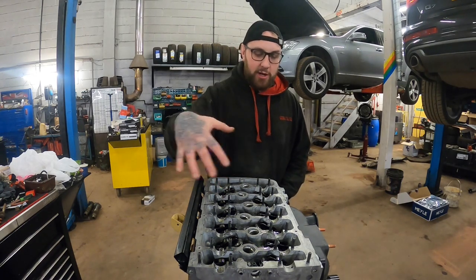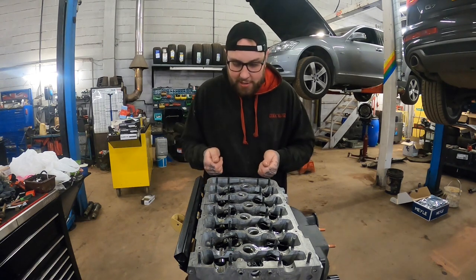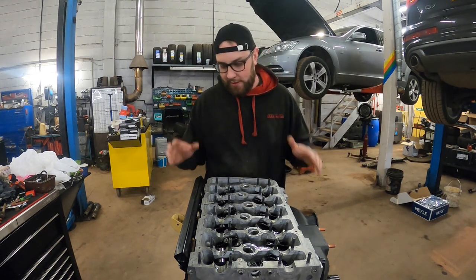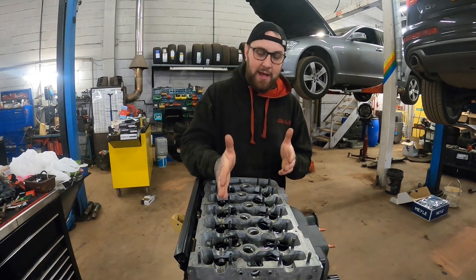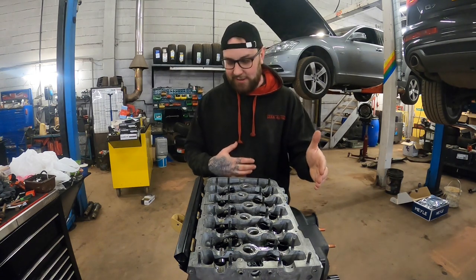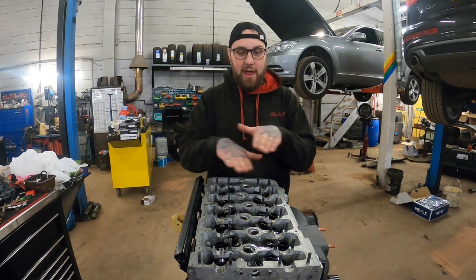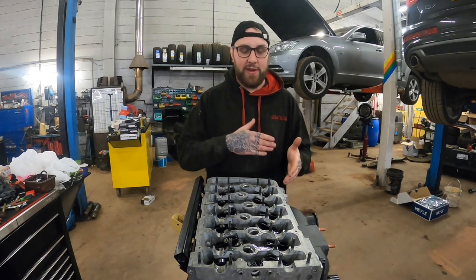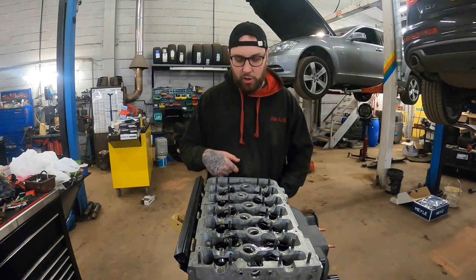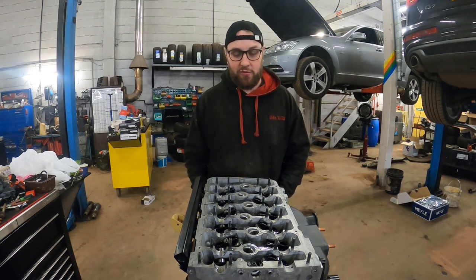I'm going to cover the rocker and lifter quickly, and then get the cams in. I need to lock the cams in - the crank is already in the right position, so the crank is timed. I've got the cam setting bar which I'll put in, sit the cams on, get the locking bar in, put all the caps on, and tighten the nuts down slowly. You need to watch out - tightening the cam down pushes certain valves down, and you don't want to push a valve down with a piston at TDC or you'll bend it.